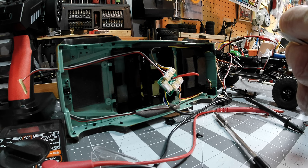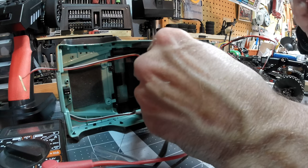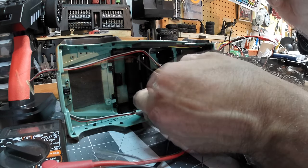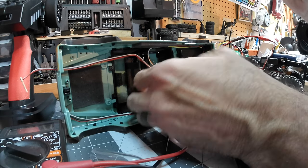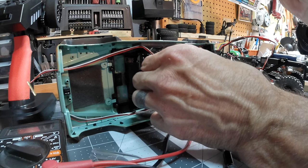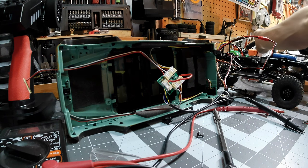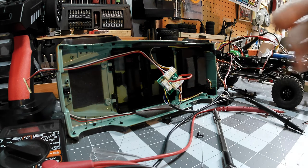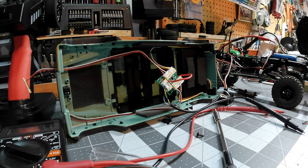Let me just get a tiny bit of solder. It's a fragile operation — really want to make sure there are no strands sticking out anywhere or making contact anywhere else on the board. You have to hit both pins; what you're doing is basically shorting out between two pins and jumping off voltage from another source. Now I haven't run it this way — this is just lighting control. I was reading 2.66 volts across everything, so everything runs off of three volts, basically.